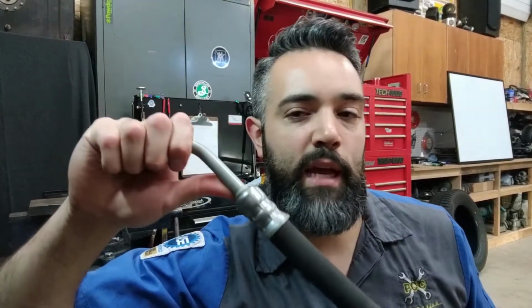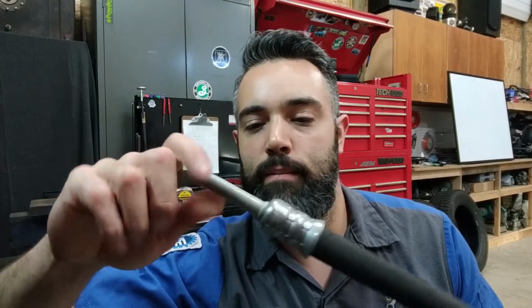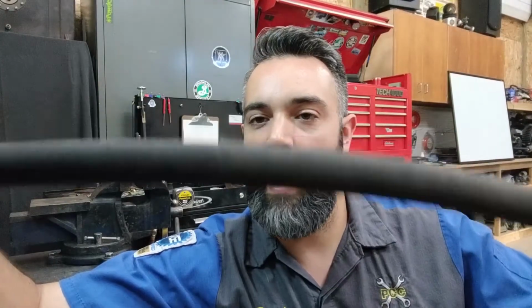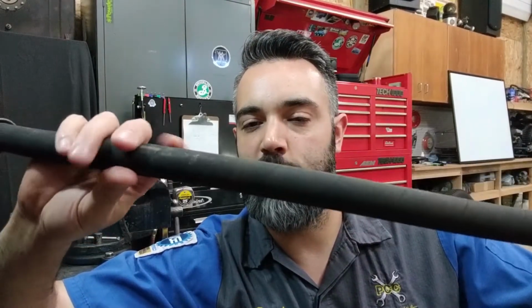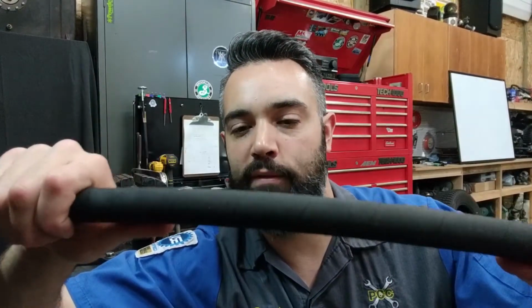Now these components are on the engine. When we're a belt-driven component from the power steering system, it's mounted to a bracket on the engine, and the serpentine belt is driving it. The engine moves and it has vibrations in relation to the chassis. The chassis is where the power steering gear is going to be located and will require some flexibility to get there. So the pressure hose is rated to operate at those high pressures. This is going to be a different type of hose. This will be more of a hydraulic pressure hose than a bulk oil hose that you can cut off of a roll.